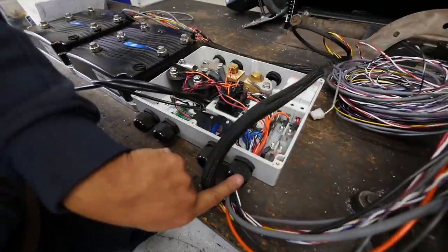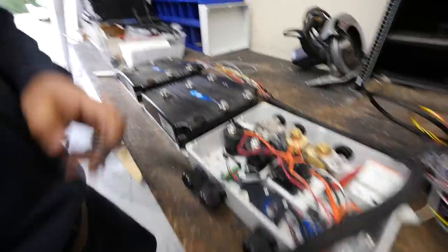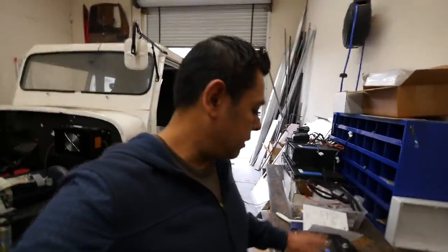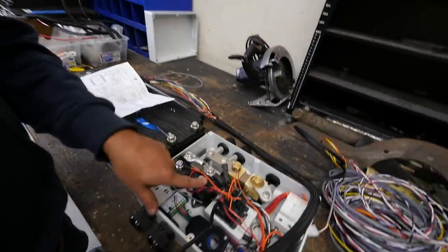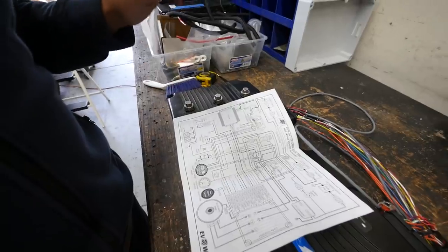I had connectors that we're not going to use, like a pass-through connector and stuff. I tried to shove everything through that one gland out here, but it's not going to happen. So I'm going to have to run another one to run the big cables for the charger. Anyway, this is the master and this is the slave. There's less cables in the slave because it just has to match whatever the master is doing. A lot of the signal cables, all the stuff for sensors — it doesn't need it because it's getting all that input from the master. What gets run on one of these harnesses includes cables for your contactors, regen, power button, and the throttle pedal signal. Other than that, it's all pretty much the same as what we did on the Gaia.